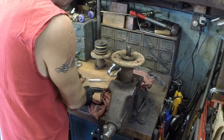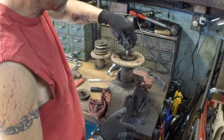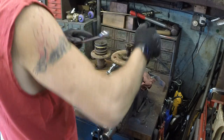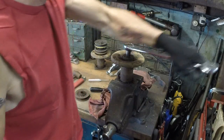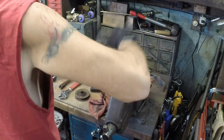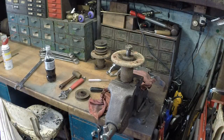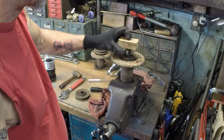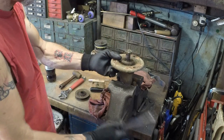What I suggest doing is taking your nut, put it on there, make sure you don't cross-thread it, take it down until it's just about flush — so you've got a nice surface. Get a nice good solid piece of wood, and you're going to take your spindle. Hopefully you've got a vise because it just makes it so much easier.